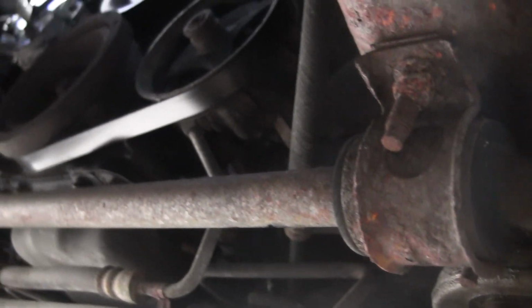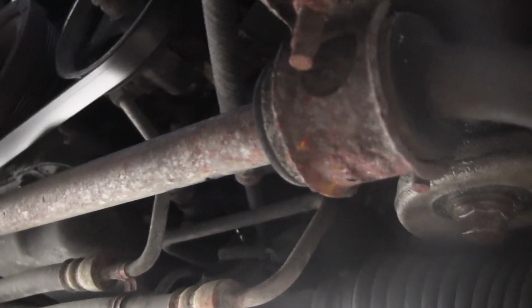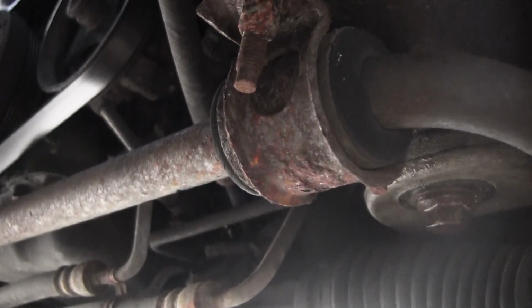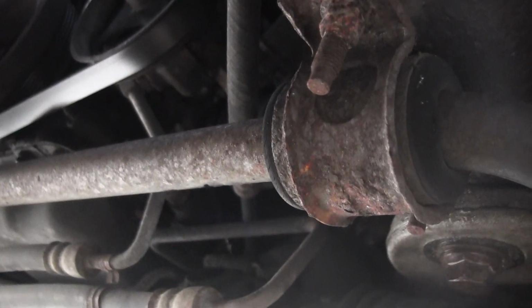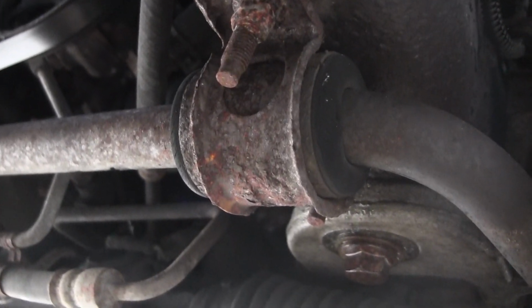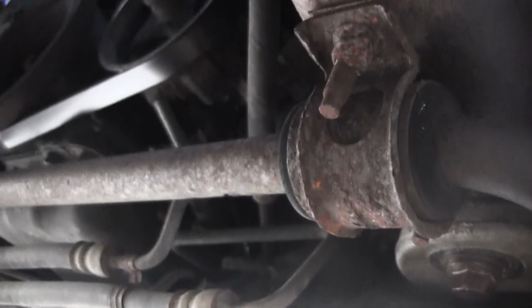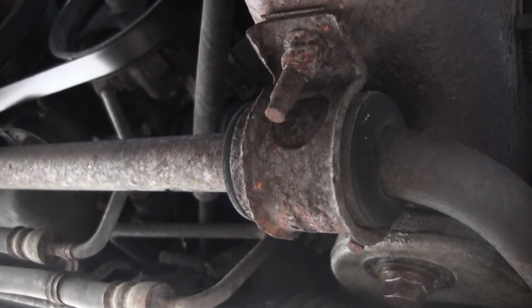It's not going to drain nearly as much as the oil pan. Probably about half a quart left in it. All you gotta do is just spin it off. If it's metal like that, all you gotta do is spin it off. There are some vehicles with cartridge filters where they're encased in their own plastic. You will need a socket to take that off. On a Toyota, they have their own special socket, and it's just worth it to get the special socket. You can get them at any auto parts store.